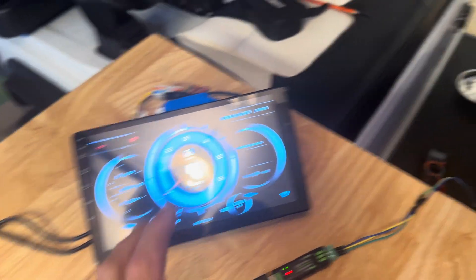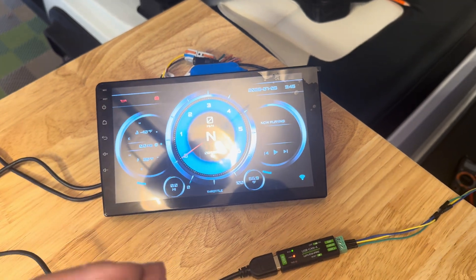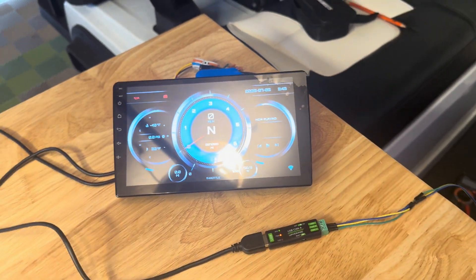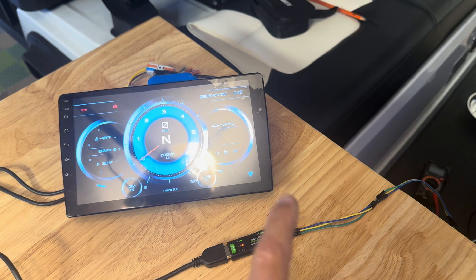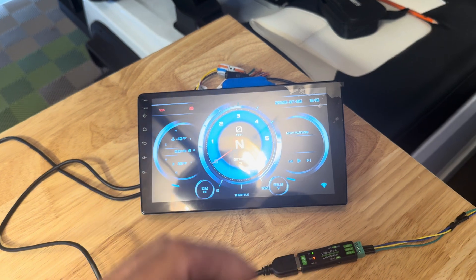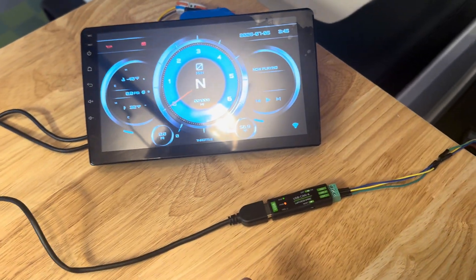Now there are some downfalls with doing this swap. One is that there is no dedicated 12 volt on the cart while it's off or while it's on, and that is causing these displays to take a long boot time — about 20 to 30 seconds to boot up. But other than that, I think it would be really cool to build our own dash, even just as an engineering example, using the data coming from the CAN bus line. I'm hoping there might be some other interesting attributes on the CAN bus — maybe torque, maybe wattage — that we could visualize in cool ways on the dashboard.